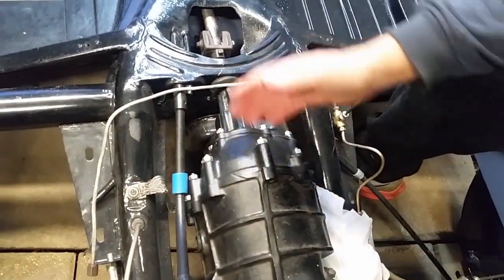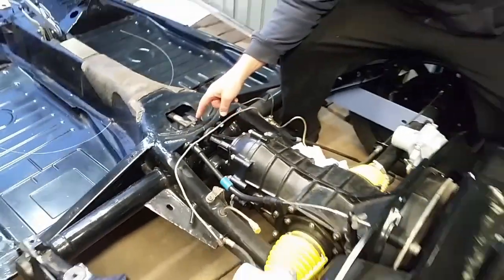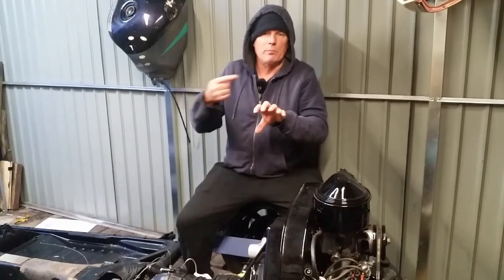So once this is back, I'll undo it. There's no oil in it. I'll undo it, and there's a fork selector. It's not on the gears, but it's on the carriers, and it's not engaged properly. I read the guidance for the Torx, but not how the fork selector should sit. You got to have it in neutral first. Now, this is in gear at the moment.